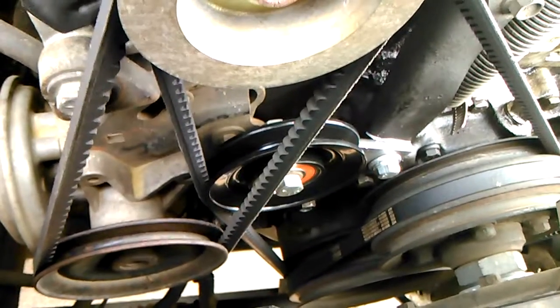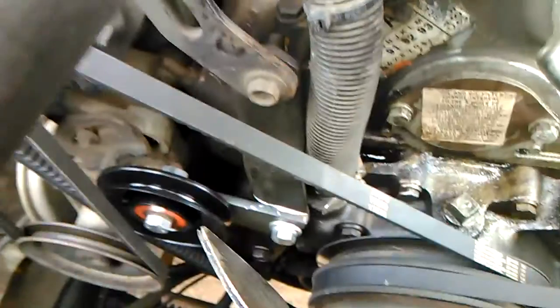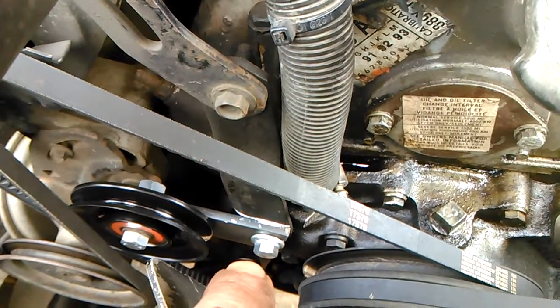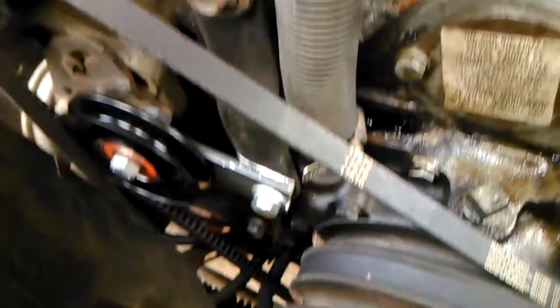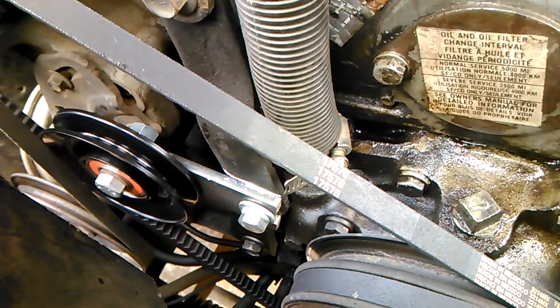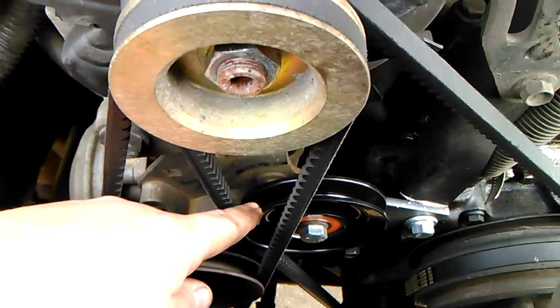So here I basically made my own little upgrade. I built this bracket — I'll get a shot from the other side — mounting on the middle hole of my alternator bracket that bolts to the water pump. I messed with the length a little bit and notched it on the end, so I had a little bit of adjustment potential to get it where I wanted it. Then I used lock washers, and some thin washers that would go on the bearing itself so the pulley could move freely.